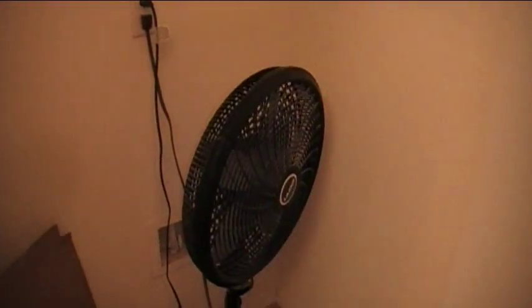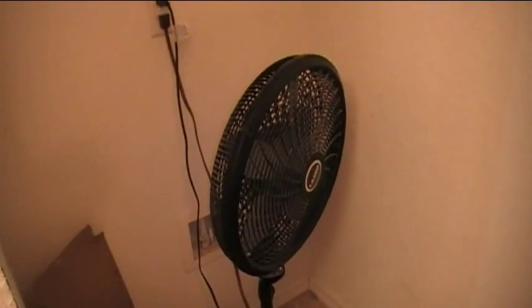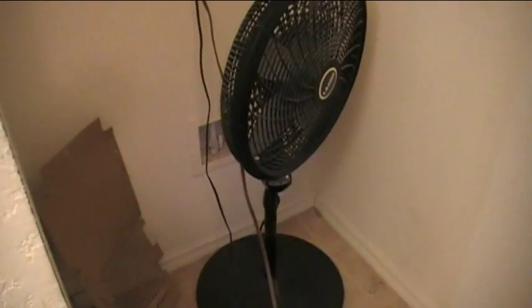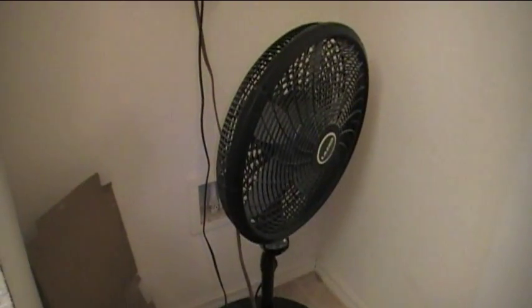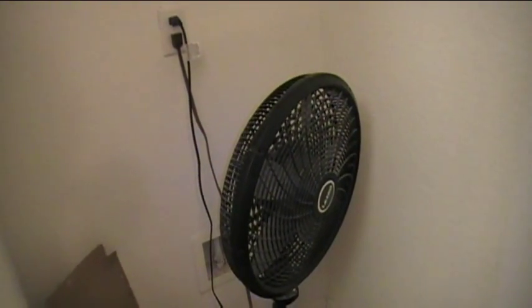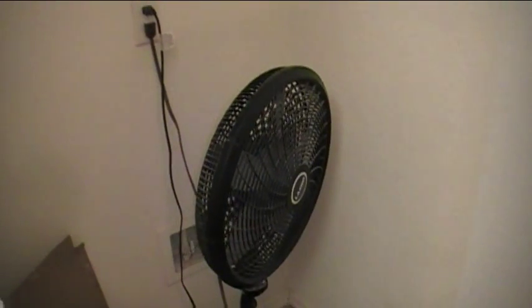Here's the top and I've moved it away from its original position — it was in this little pocket here in the wall. After the fan failed, the first thing I did was put this little fan here to keep some air circulating and keep it cool. If your condenser fan motor ever fails, the first thing you want to do is put another fan in its place temporarily to keep everything cool.